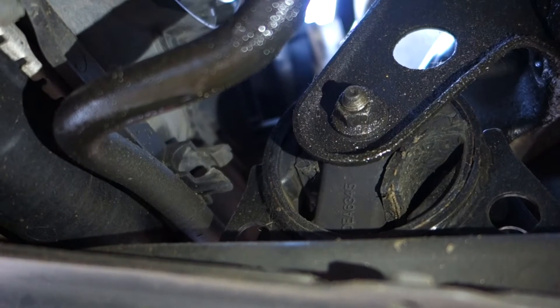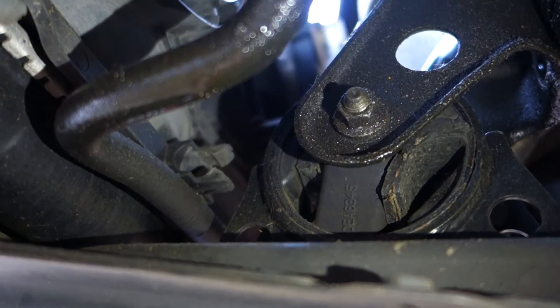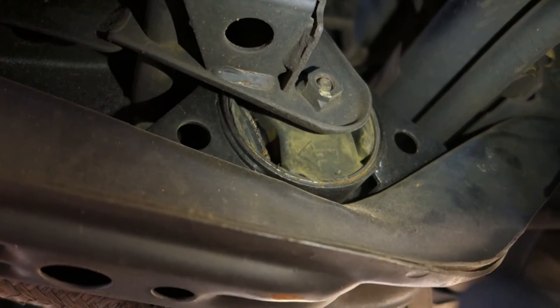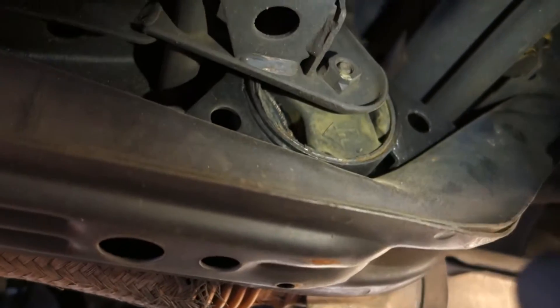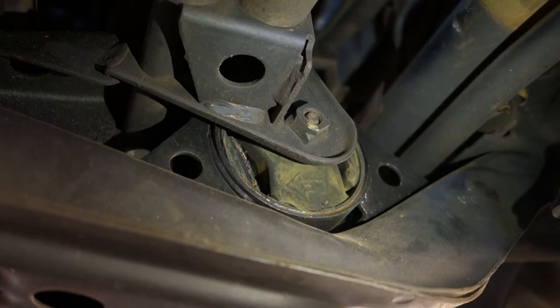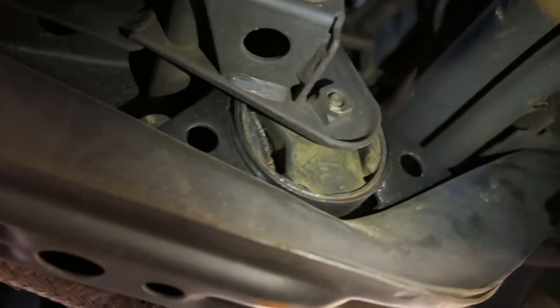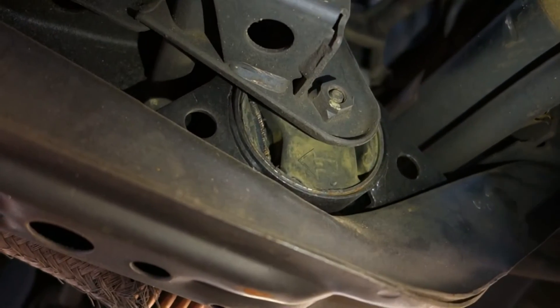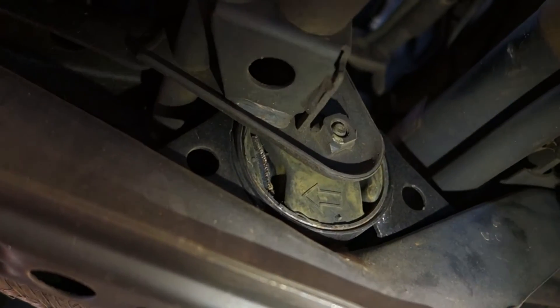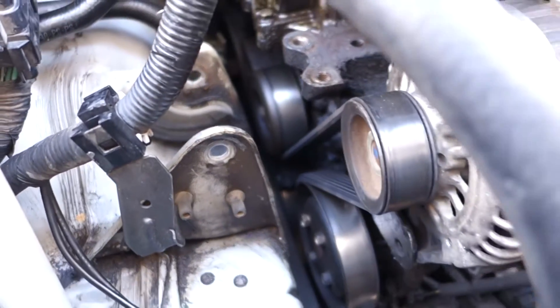Here's a little something custom - pieces of a tire as motor mount inserts. I got tired of doing these things three times, especially the rear one. That back one holds the torque of the whole motor and kept getting damaged just from hitting bumps. It needs to be twice as wide, like on the Maxima. I shoved pieces of tire in it and it's been good ever since. It's a $12 part but I was stripping out the bolts that go into the frame.